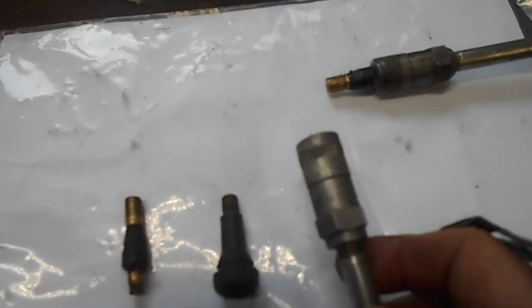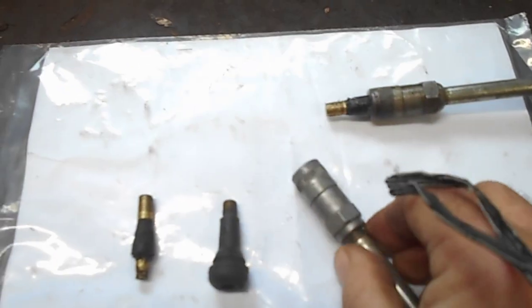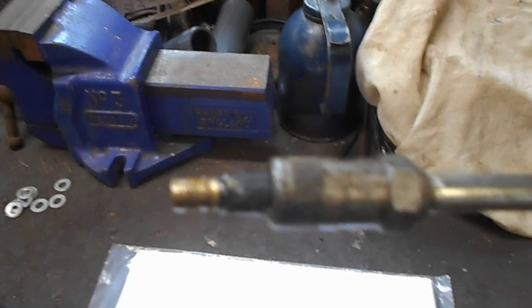It's 28 threads to the inch — that's a standard used older grease gun nozzle with a large diameter. I ground this down to fit it in the end, to produce this tool, and I'll go back over to the snowblower.